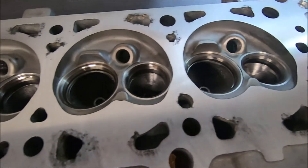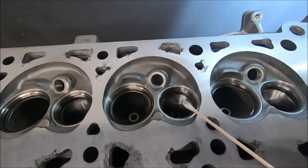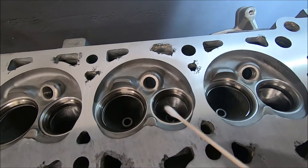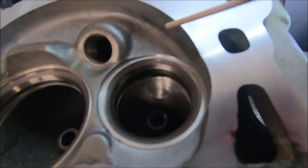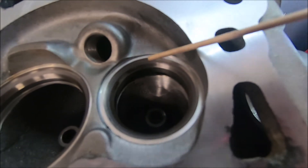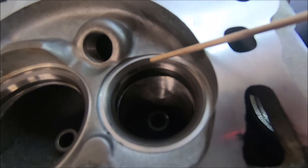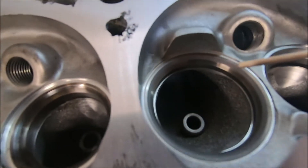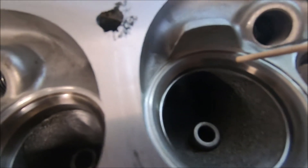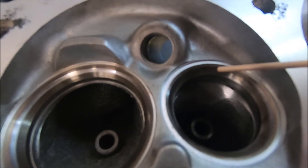This head — I've already done a couple of valves. I'm going to do this set right here on video. I've already done this set. You may be able to see the area right here — it's kind of discolored, about two millimeters thick. That is the area that's left over after lapping them in. This side does not have them yet.